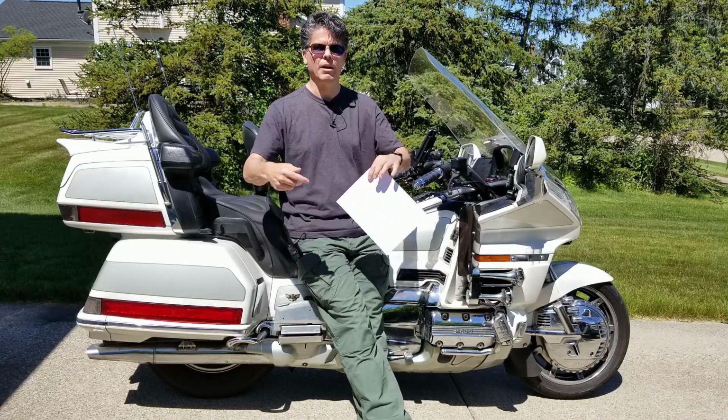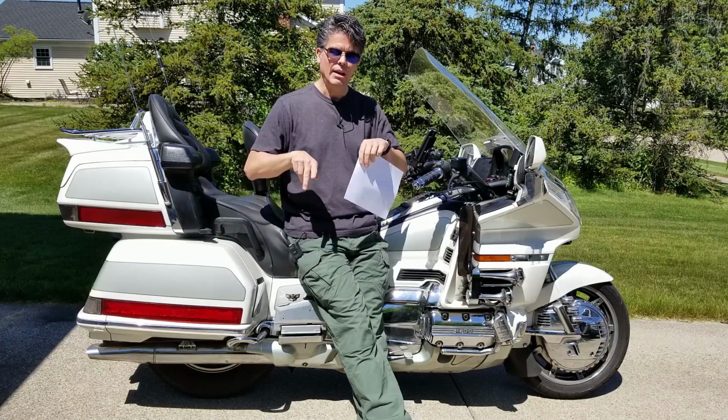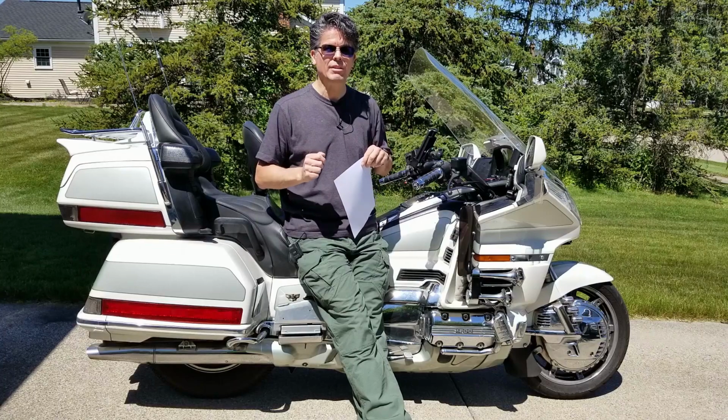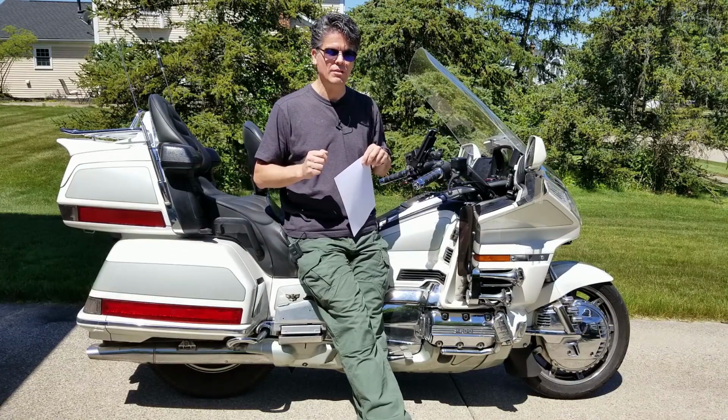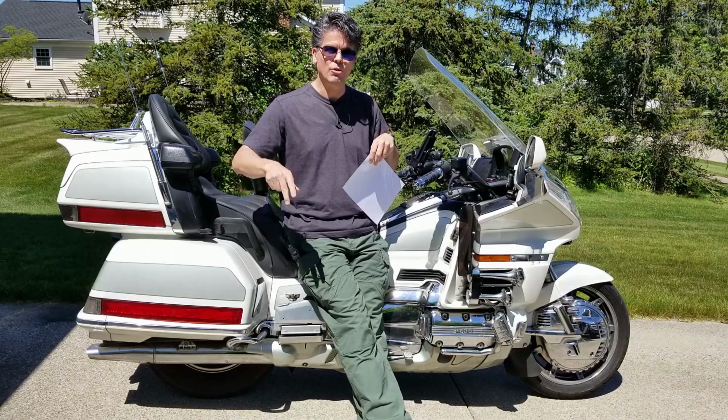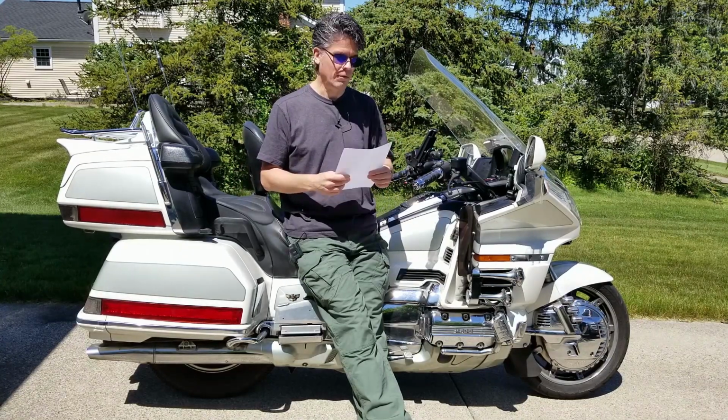So if you take out the spark plugs and then crank the engine, it'll eject that gasoline out of the engine and allow it to turn. Make sure the ignition is off when you do this, because if the ignition is on and it sparks when it's ejecting gasoline, it turns your bike into a blowtorch, and that'll be a very bad day for you.